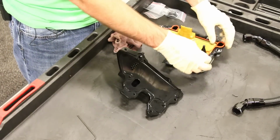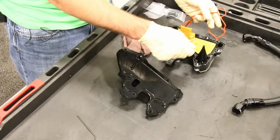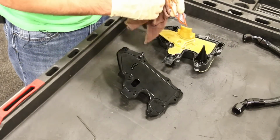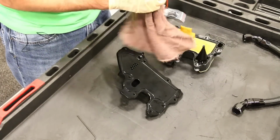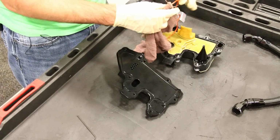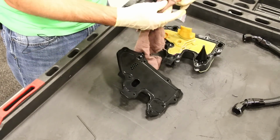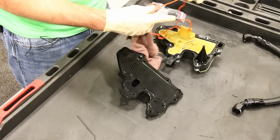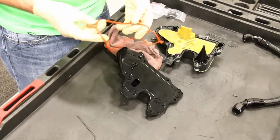All right, so this gasket we pulled out from that PCV valve. You do have to kind of peel it up, so be careful you don't just yank on it and end up breaking it. You will have to replace it. We'll link to the replacement one in the description in case you need one, in case yours is old. This car is pretty low mileage, but if you had higher mileage, you might consider replacing it. And I'm just gonna clean this thing up a little bit, get some of the oil residue off, and then we can throw this in place.